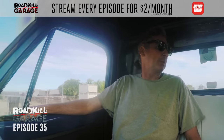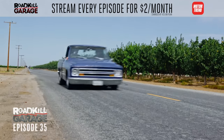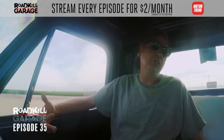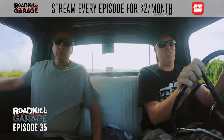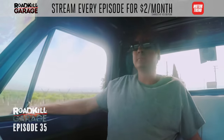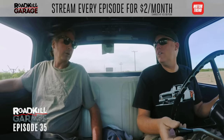I can detect the sound of superpower. A little rich — 10-to-1 air/fuel. It's not fast because it has no timing and it's pig rich; we haven't done any tuning, changed spark plugs, nothing. But the carburetor is actually really good. That's not bad at all — running pretty good all things considered. My anxiety is much less now because I thought the carburetor could be a disaster and it's not. I feel good enough to drive it to West Tech — it drives like a brand new car.